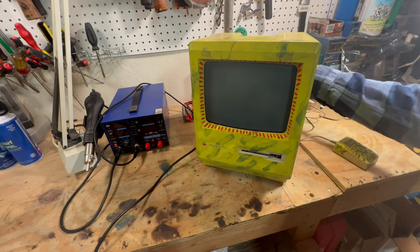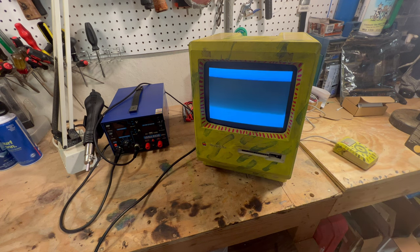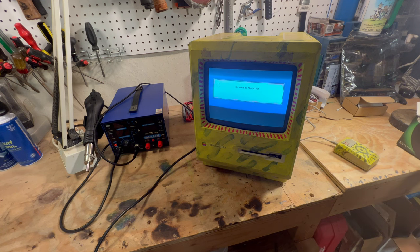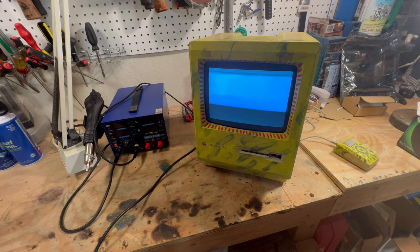We're going to turn it on — it's got the Blue SCSI in the back of it. It's going to boot up and the screen is going to do its weird thing. We just have a mouse hooked up to it as well. There we go, now it's got the old Happy Mac on it — it found the Blue SCSI. We put the magic diode in it that allows termination power, so we can boot right off the SCSI without having to use the floppy drive.